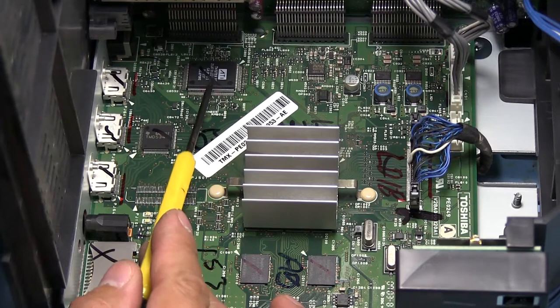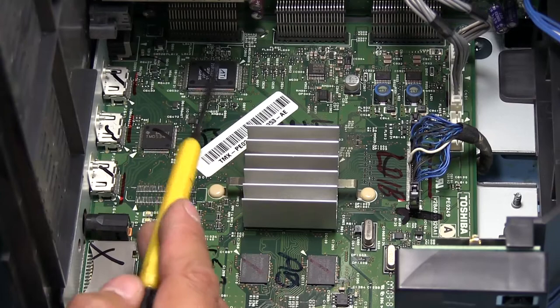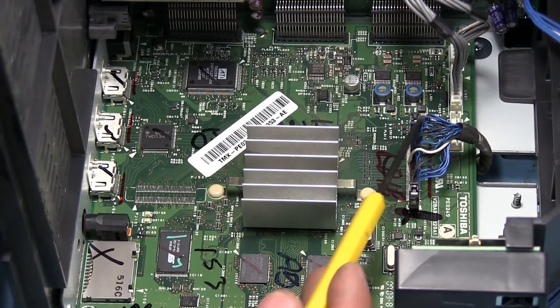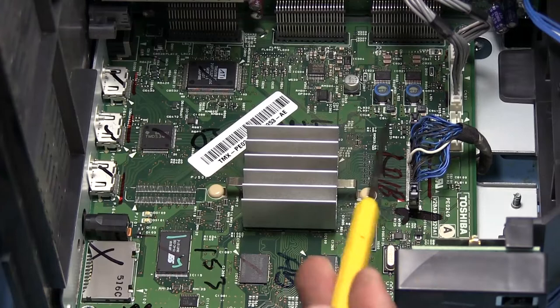On the digital board, there's an ATI-branded chip all the way in the back. I'm going to assume that's probably either a decoder for the over-the-air signals from the antenna connector, or maybe it's got something to do with analog switching. Here's our main scaler, we've got some memory for that, and there's a flash memory right here. This is our LVDS connector going off to the projection unit, because basically the projection unit is just acting like an LVDS display with its interface.